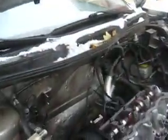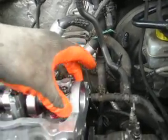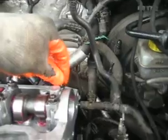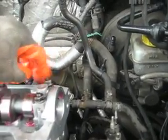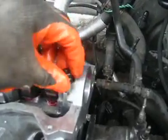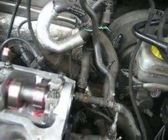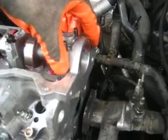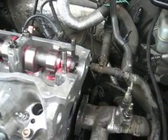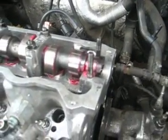The end of your cam — I suggest that you take off this cam holder here at the end. Once you take that off, I've got a nice little spot to put my nuts. The lubricant I opt to use is always synthetic bearing grease. I use that because it doesn't break down quickly, but also because it provides a stable lubrication even after the presence of motor oil. And if you're using synthetic motor oil, they bond very well.